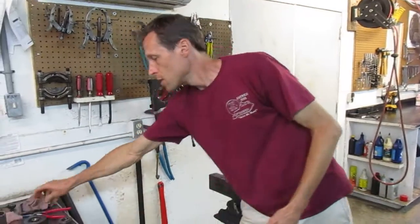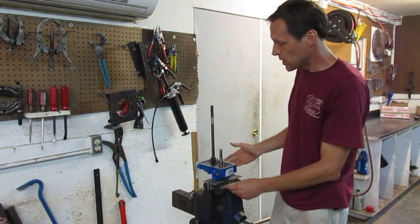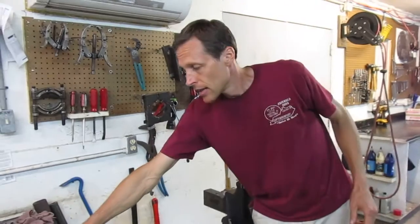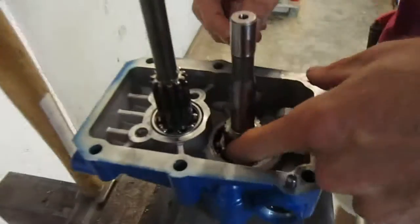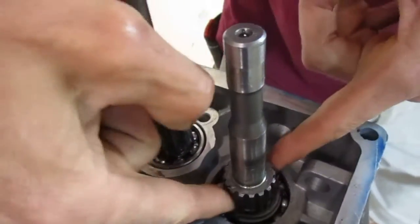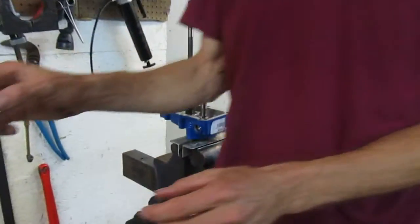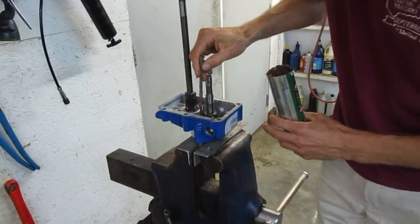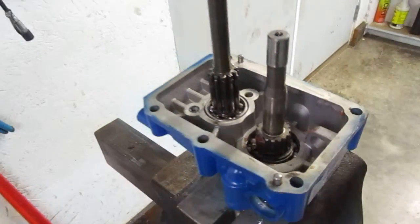The first thing we're going to do is position the detent spring. I've got the rear cover of the transmission removed — this is off of a BCS 732, and this cover is being replaced. This is the detent spring — a little spring that goes through a hole drilled all the way through the shaft side to side. I'm going to shove that in there. On either end of that spring there's a ball. I'll take a little grease — a great trick to hold the balls in place — and paint some grease on either side of that spring hole.